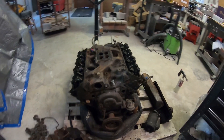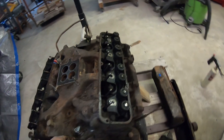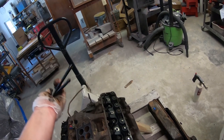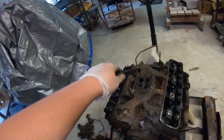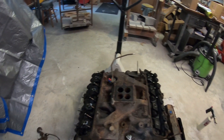All right, so I've got a lot of stuff off this engine right here. Here's all my bracketry and things that I'm going to reuse. There's the old compressor, water pump slant over there. I got the valve covers off here. I'm going to pull these push rods out, but I don't think I'm going to keep any of them — I think they're all trash. Take the bolts out for the intake, and then I'm going to put a little carb plate thing on there, hook it up to the hoist, try to get it off there. I had to cut the distributor off — it wasn't turning or budging. So we're making progress.